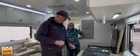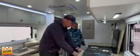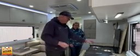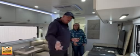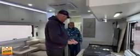Okay. So if you hold the button in, now I've got no gas at the moment because I've turned off the gas bottles, but you just hold it in, keep clicking, you'll eventually see it light. Now it might burn for a bit, then start to simmer down, and you might need to relight it. That often happens when you're trying to get the air through. Second time you light it, it should be lit and it shouldn't have any problems after that.